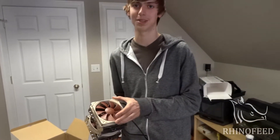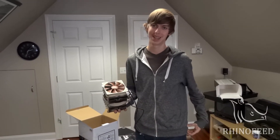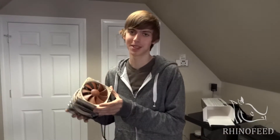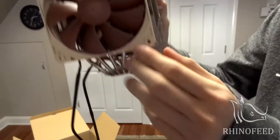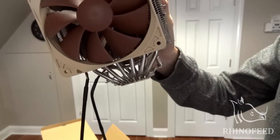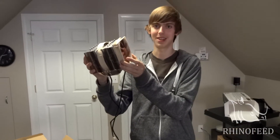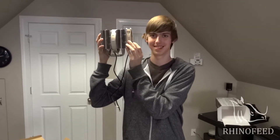Thank you for watching my unboxing video of the Noctua NH-D14. This actually performs on par — or at least almost — with the Corsair H100 liquid cooling system, but it's a lot quieter, especially if you don't upgrade the fans. A couple things I forgot to mention: they have a 120mm fan on the very end so that you would not have RAM clearance issues, and the 14cm fan allows you to cool motherboard components on the other side because it reaches even further down. And lastly, I wanted to show you the obligatory headshot comparison — this cooler is gigantic. It's huge.